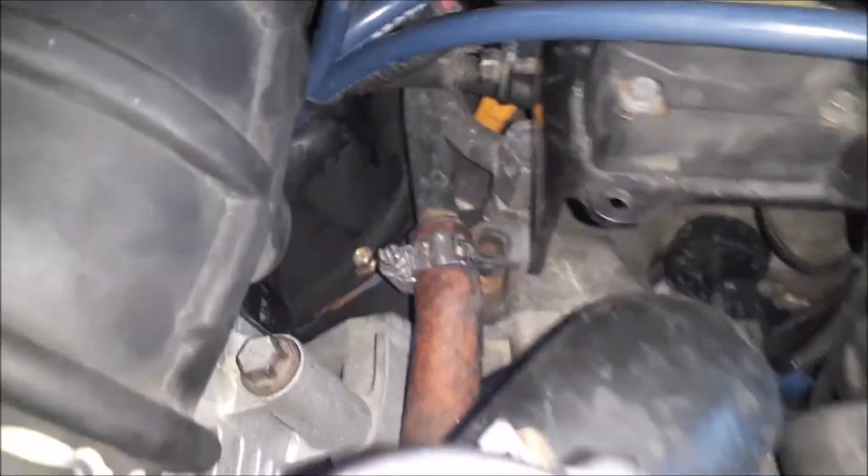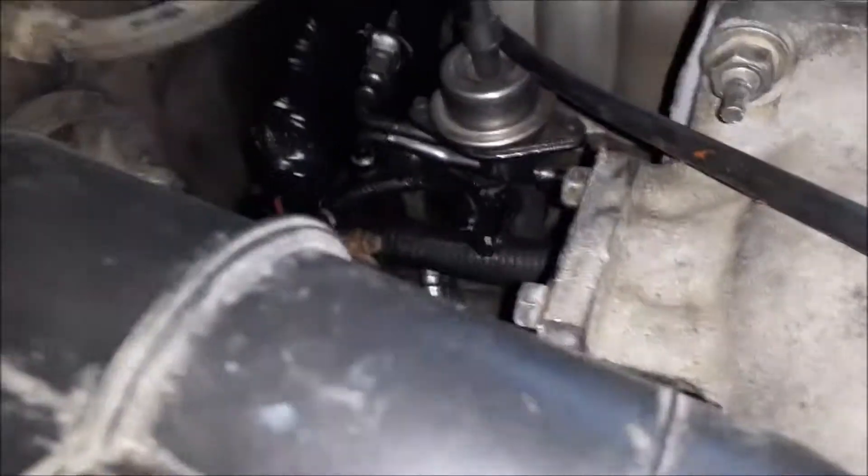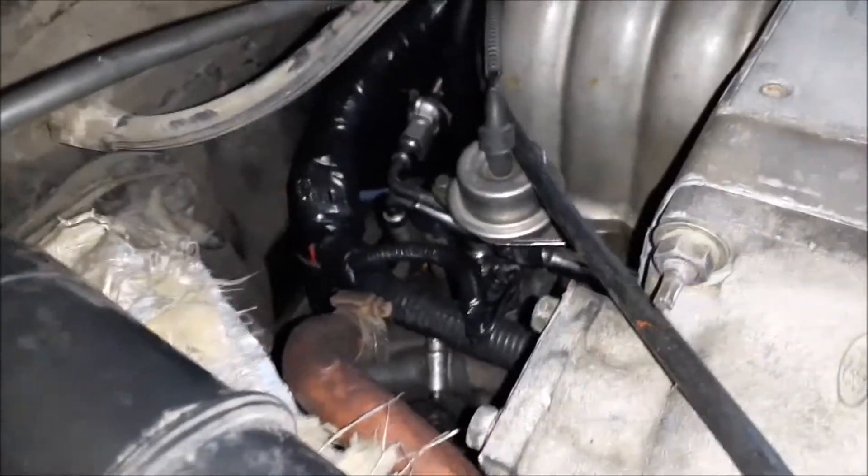As you can see, that's how much clearance there is between the front and the radiator itself. For the heater hoses, I ended up running them with the stock pipe — there was an Explorer pipe that routed to the back, so I used that and it routes back and goes into the heater core. Since this is a '94 and uses a blend door instead of a vacuum-actuated system, I didn't need heater valves. I did have to shorten one of the lines though, because the heater box on the Explorer is different.